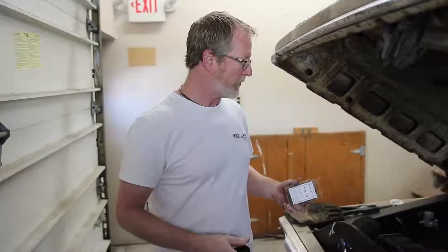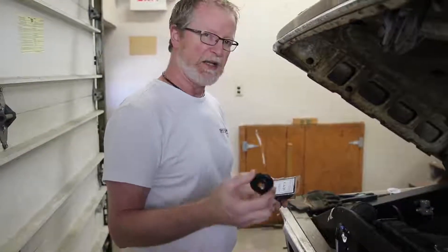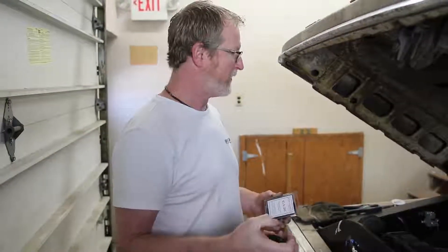When you're planning to start running your wires, it's really important to check where the wire is going to be passing through. If they're going through any panels or firewalls, you really need to use some kind of grommet or protection so that the wires don't chafe. We offer grommets that fit about an inch and a quarter hole — they have a bit of a lip so they do open and close a little bit. They're flexible and it's a perfect size for this truck.